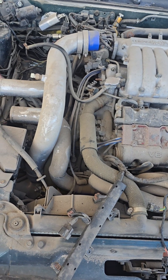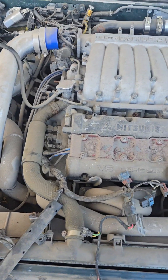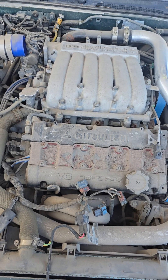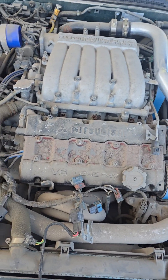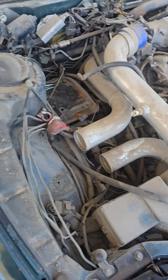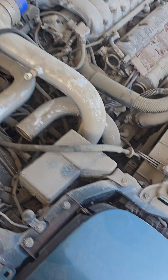I've coated myself completely in dust, but I've got a lot of things unplugged. I've got the intake manifold already loose. So we're going to go ahead and pop that up and start pulling the rest of the harness out. There's a couple connections here and there, so I may have to remove some of this charge piping to get to it.